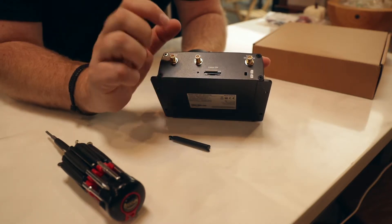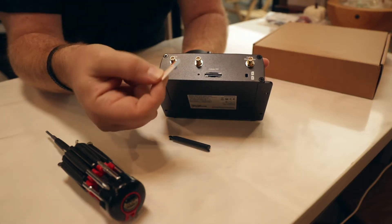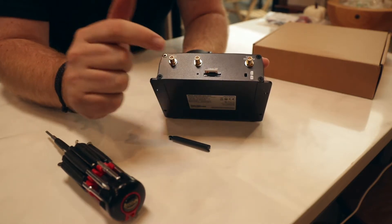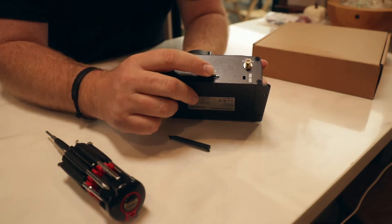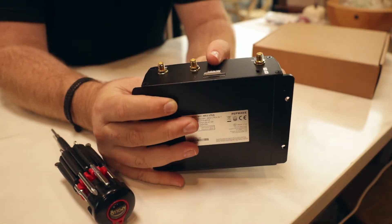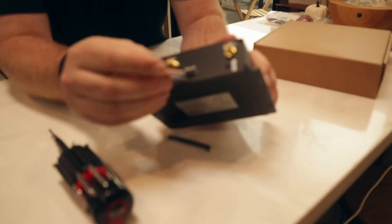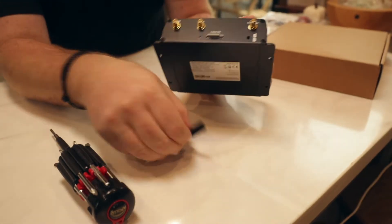You should be able to just push the SIM in and you'll hear it click. Don't push any further than that — it allows you to get the card in and out easily. To remove it, push in again and the card will push itself back out. Note that sometimes the push mechanism is already engaged, so if you don't hear a click don't over-force it. The SIM will still stick out a bit when fully inserted. Once you hear the click, you can replace the dust cover.